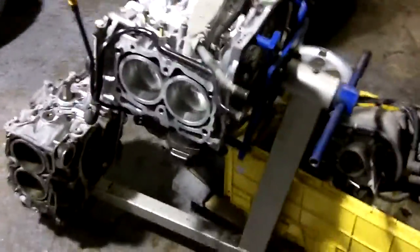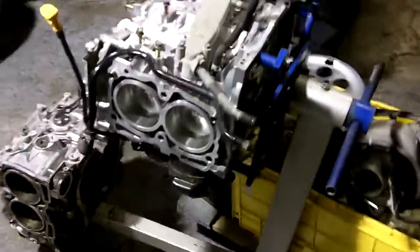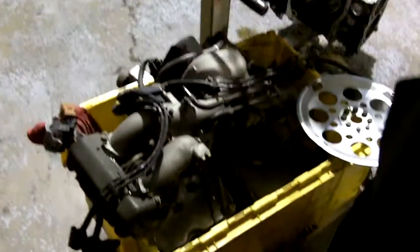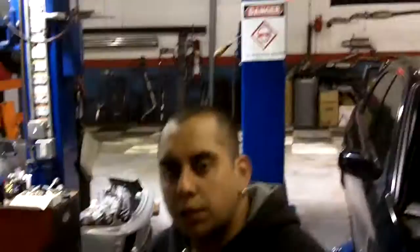It's a pretty wild engine. I've only dealt with cars from the 70s so I'm not used to especially these four cylinders with cylinders on both sides — they have two heads on a four cylinder, which seems unusual. And the intake manifold, like I said, it's eight bolts and it comes off as one big giant unit, so I can just leave everything basically attached to the intake manifold and pull it off as one part.